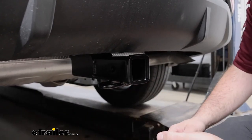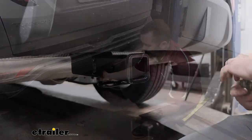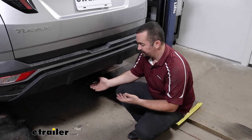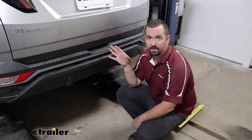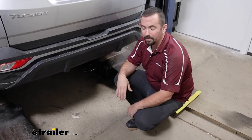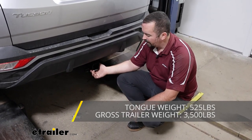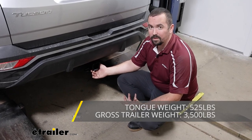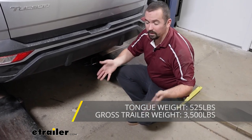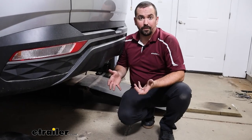The rolled-style safety chain loop makes it easy to attach standard S-style hooks or even a larger clevis style. If you plan on towing a trailer or loading cargo carriers or bike racks, make sure you're not exceeding the weight capacities of the hitch or the vehicle — always take the lowest number. This hitch has a gross trailer weight rating of 3,500 pounds and a tongue weight rating of 525 pounds, which is enough for a cargo carrier or a four-bike rack loaded up.